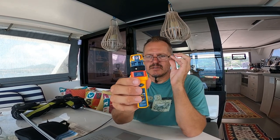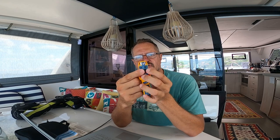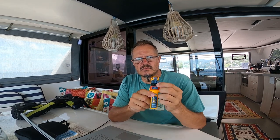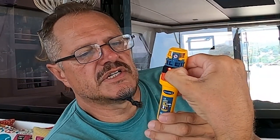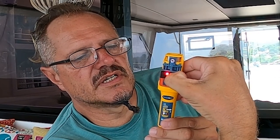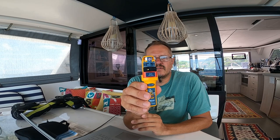So that the light is exposed and you can still press the button. To program it, you need to hold the button for 15 seconds. In that 15 seconds, this one light will flash fast red, then slow red, then green. The moment it flashes green you need to release this button. Okay, it is slow flashing... fast flashing red, there it goes to slow flashing red. I think I need to wait another five seconds - there's the green, release it, and then it flashes green.